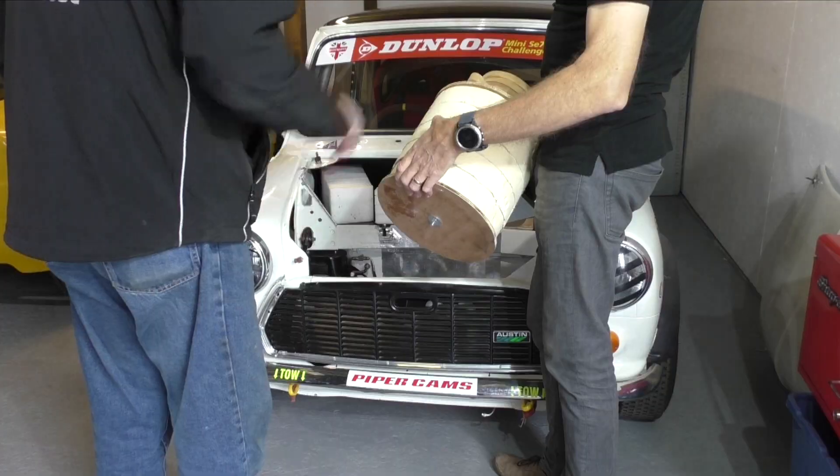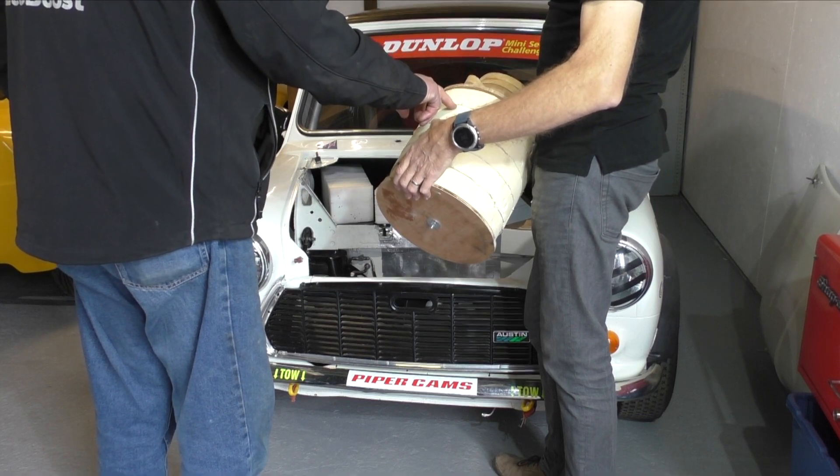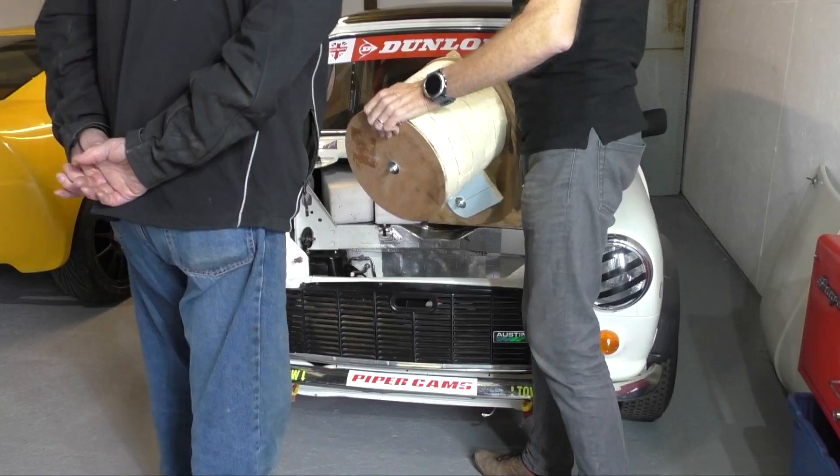What RPM does it run at? 12,000 RPM. And the reduction from the motor to the final drive — about six to one. The torque is going to be tremendous. We went for this ratio so we could get about 120 miles an hour top speed and 0 to 60 in theory of 3.2 seconds. On paper we're trying to get that traction with those wheels and tires — on slicks on the track you might get there. Certainly going to be exciting.